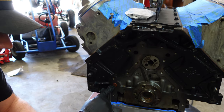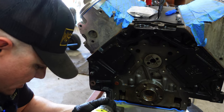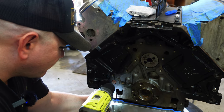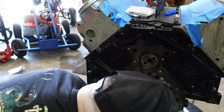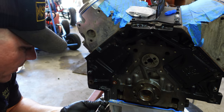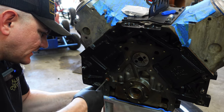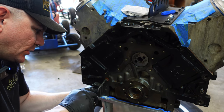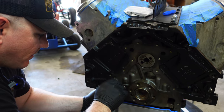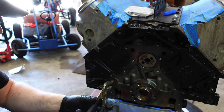We're going to take this one out — it's a pretty simple process. We have to drill out a little tiny hole into this one. I definitely don't want to go too deep. Then we're going to take a little screw, screw it in there, and hopefully this thing will just come right out. I really wanted a self-tapping screw, but this'll do. It's starting to spin, and then we should just be able to pull it out.